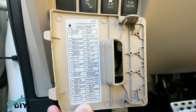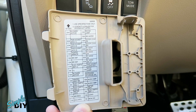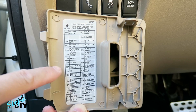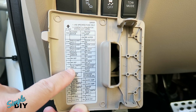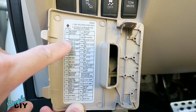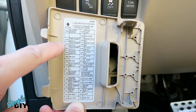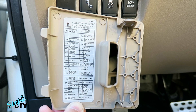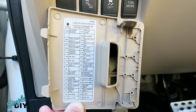This is a good reference to use to find out which fuse has ignition 12V and which fuse has constant 12V. For this Nissan Pathfinder there's a 10 amp fuse labeled electrical parts BAT2 — this will give me constant 12V. There's also a 20 amp fuse labeled power socket ACC1, and this will give me ignition 12V. Every vehicle is designed differently, so the fuse labels you see here will be different than what you see in your vehicle.